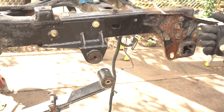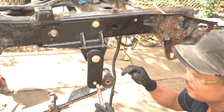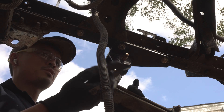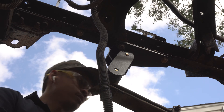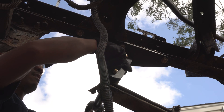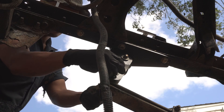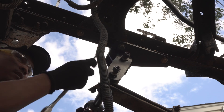Now let's get these shackles on here. I did already put some wheel bearing grease on the bolts. Just throw them on there, and we are going to have to manipulate that leaf spring a bit in order to get the bolts to seat properly. Now let's get the opposite side mounted — similarly, we'll have to manipulate that leaf spring. We really just need the bolt to go in the hole and we'll let the threads do the rest of the work. Now we can put anti-seize on both, then a washer, and then our nylock nut. Then we can snug it down with a 21-millimeter socket.